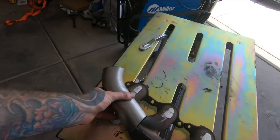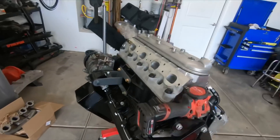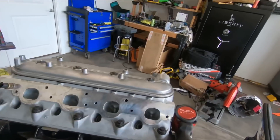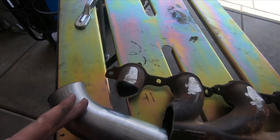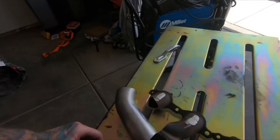I'm going to go ahead and get it all tacked up. I've already pre-fit it to this side. With the angle that's on there, it comes really close to this coolant temp sensor. So I think once I get it all on there, I'm probably going to end up chopping it here and giving it a slight bend away from that coolant temp sensor — that should put it right where I need it. Got the welder rolled out here. Just got to set everything up, get a couple of tacks on this. I need to clean this up just a little so I can get those tacks to sit, then I'll be right back once I get it tacked and outlined and we'll get to cutting it.